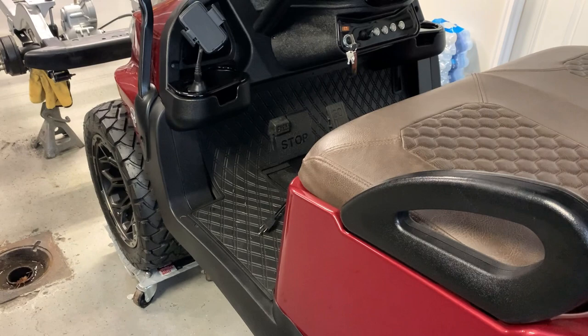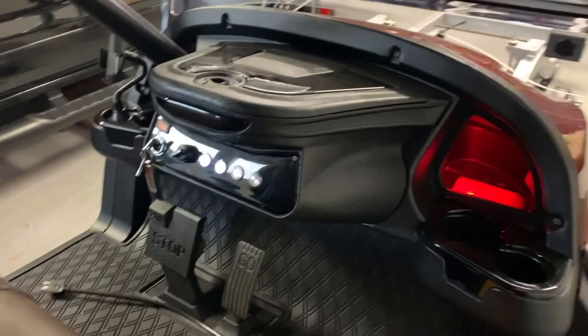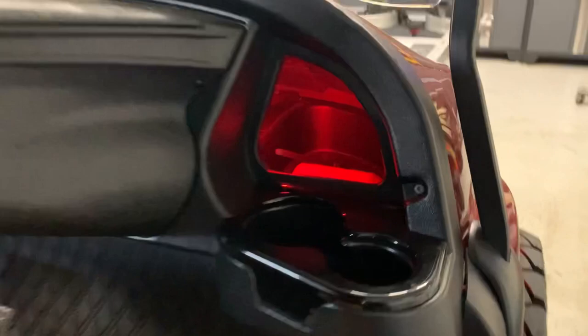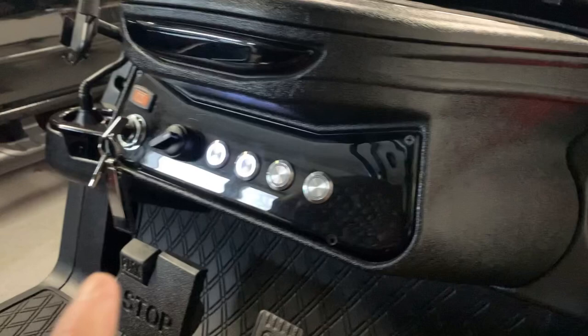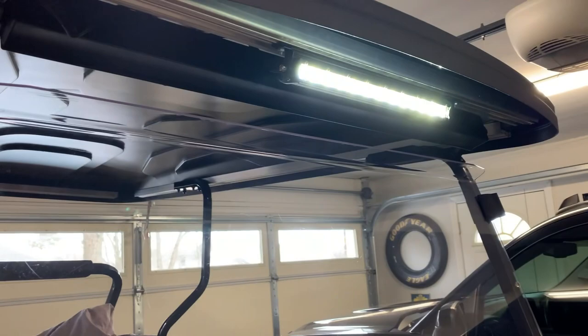It is winter and we're in upstate New York — about 30 degrees today, so I'm not going for a ride. The underglow is on, and in there is where I stuck one of the LED strips so at night I can see in there. Those little buttons I got on Amazon — you can wire them a couple of different ways: have them light up when pressed, or on all the time. I have them on all the time, wired to the key, so when the key is on they come on, and then you just hit that and the accessory light comes on.